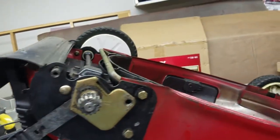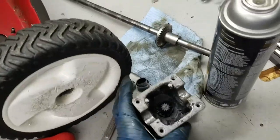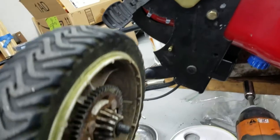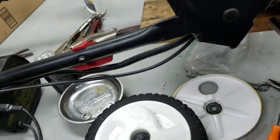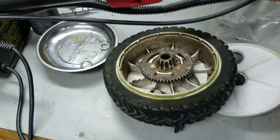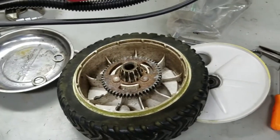That's really about all the problems I can think of with the system. It actually seems to me to be a pretty good system - I've seen a lot worse. A lot of mowers have plastic here, but these are all metal. I don't know about all models, but this is a 2007 model and everything is metal on this one. If the wheels are getting stiff to turn, these wheels roll on the bolts - they have shoulders on them that roll on the inner races. I greased these before I put them back.